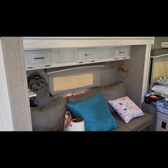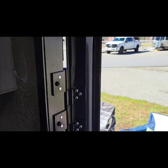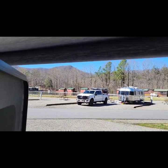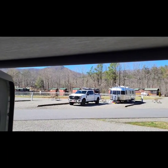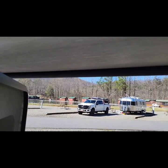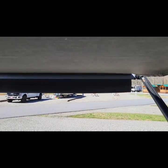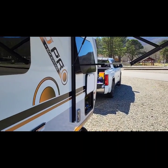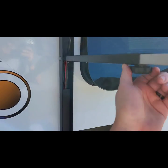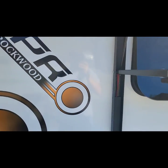Now I'll show you the awning operation — it's pretty easy, you just extend it. The one thing to keep in mind: awnings are not made for high wind. If you've got wind, just pull it back in. You see it all the time — people leave these out when they go somewhere and come back to find them wrecked. You'll see about where I stop mine — when that little flap comes out, boom, I stop, then I tighten these arms, one on each side. You can cut pipe insulation and put it over the arm because I've knocked myself out about 14 times — it certainly hurts the head a lot less.